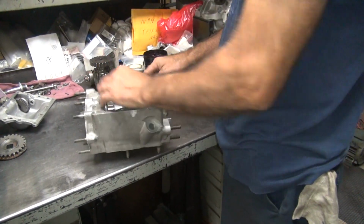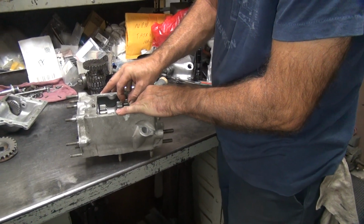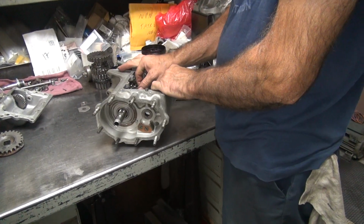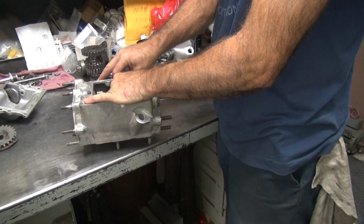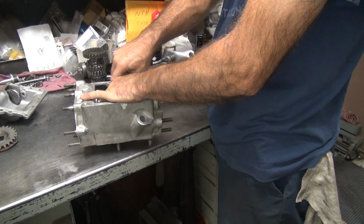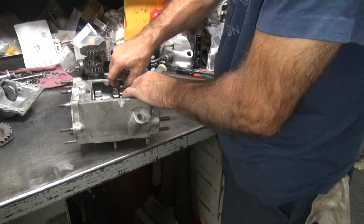Yeah, now I can tell how much play third gear has. Look at how loose that thing is. See, now I don't like third gear fit. Look at that. It seems a little loose. How'd it fit on the shaft? Pretty good. Yeah, it's got some play. What if you hold the gear straight and see what it does? Well, I'm sliding it back and forth. It's not rocking, that's sliding. That looks like more than 10. Yeah, it's quite a bit. It's more than I like.